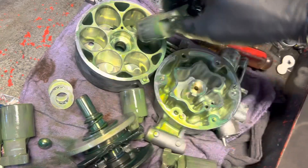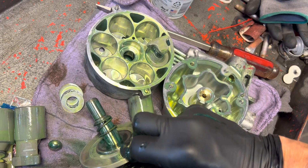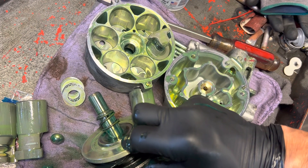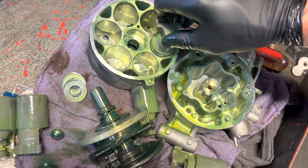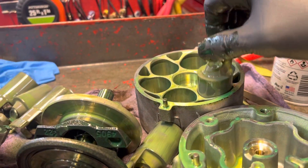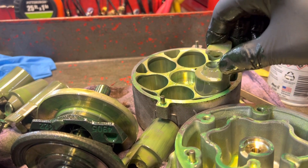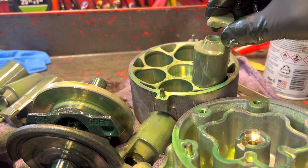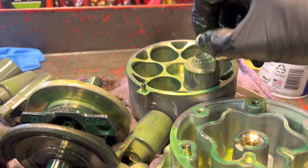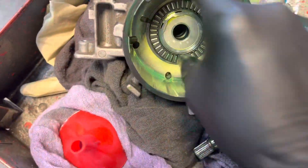The pistons move back and forth inside their bores - that's how you get your displacement and compression. When it gets a command and satisfies cooling, you see this start to move and the pistons will just go back a little bit. If it only needs 20% capacity, the pistons will go in and out just a little as the plate only tilts a little bit. But when you have a heavy heat load, it gets the command to move the plate more through the actuator valve and the pistons will go up and down more, moving more refrigerant.